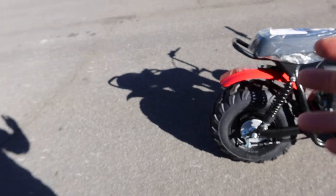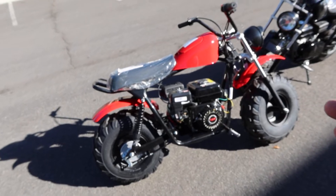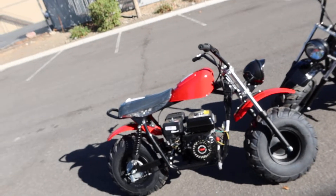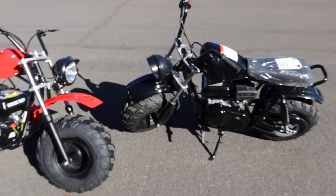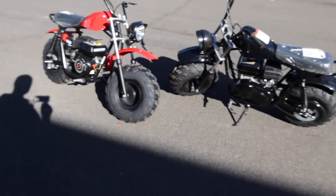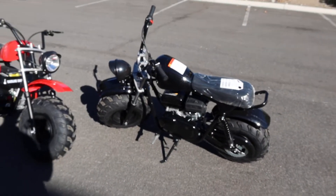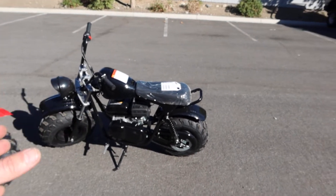Really nice looking and well made. I'm really impressed with the Mudstar. I do sell the Trailmaster as well as the DB200 from Tao Motors, and there's the Coleman as well — I've had a couple in here for service. It has drum brakes and is chain driven. Now on some websites it does say CVT, but it's not a CVT belt drive — it's chain driven.